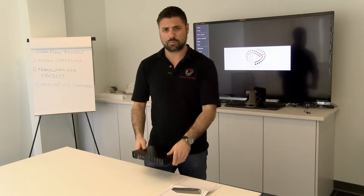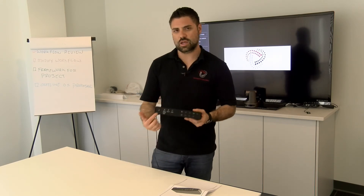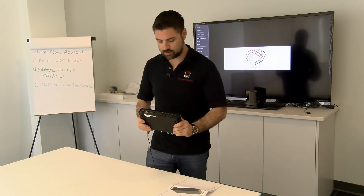I started testing it, started playing with it, and played with the web browser interface. It's actually very straightforward. I set the box to DHCP, downloaded a free IP scanner, and looked up the MAC ID. Within about two minutes I was able to get into the box, adjust my streams, adjust my resolution, and then realize there are a ton more features. USB 3 on the front is for recording — you can actually record multiple channels onto a USB stick right from this alluring box.